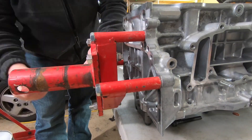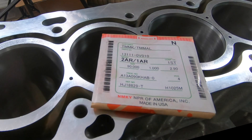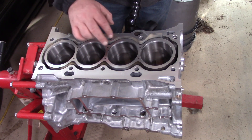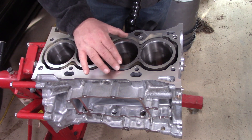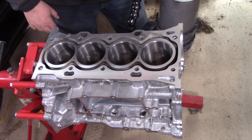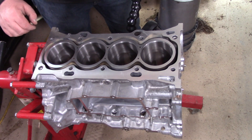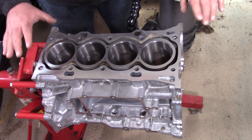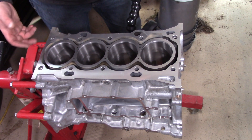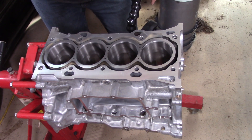Let's finish mounting this on the engine stand. As you can see here, I got the block back from the machine shop. I got the rings and they're actually made by NPR — Nippon piston rings — which means the hone we've got on here is the correct hone. These bores, after somewhere between 25 and 30,000 miles of endurance racing, had ovalled out by about five to ten thousandths of an inch. They were able to put a new finish on there and only had to overbore it by two thousandths of an inch, or 0.05 millimeters, which is well within the 0.17 millimeters Toyota specs before the block is to be thrown away. Now one thing that was technically out of spec — Toyota states that if you have more than 0.05 millimeters of warp, the block is to be thrown away. I spoke with the machinists and we both believe that number is excessive, especially with the VVTi system and the tensioner. He had to machine the deck down four thousandths of an inch, which is just a little bit over that 0.05 millimeter spec.